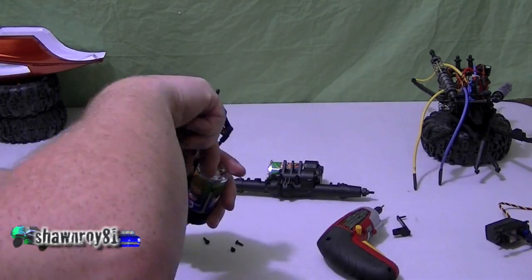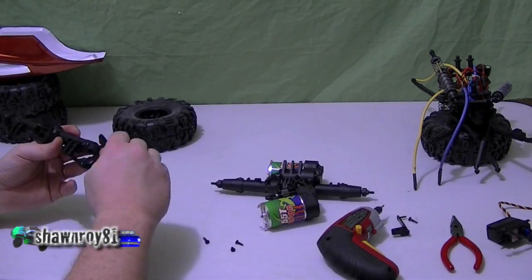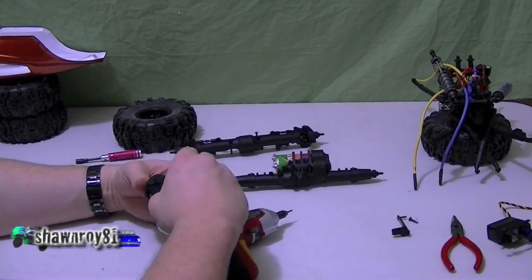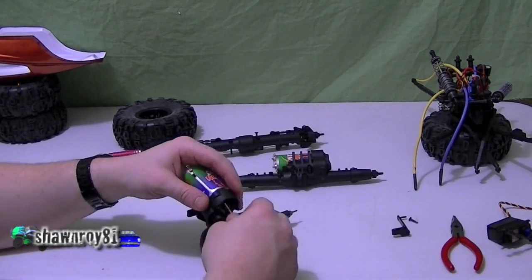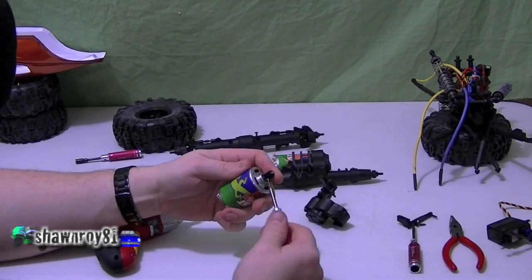And if you're watching my earlier build, the reason I can do this without having to pull the whole axle apart is I cut the motor mount at the bottom. There's a little gap that goes where the axle should go through. So by cutting that out, I'm able to pull out the motor here. Just 2 long bolts for the motor. Get her pinion off.